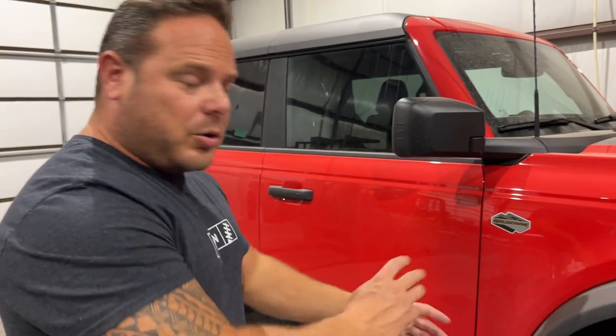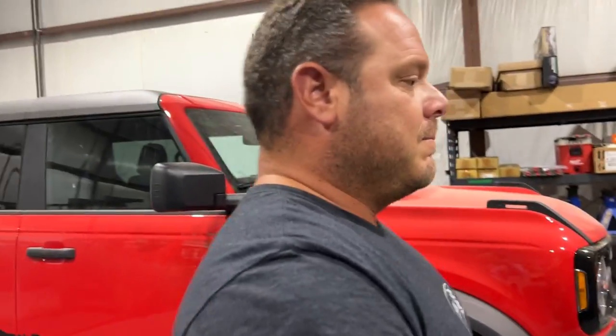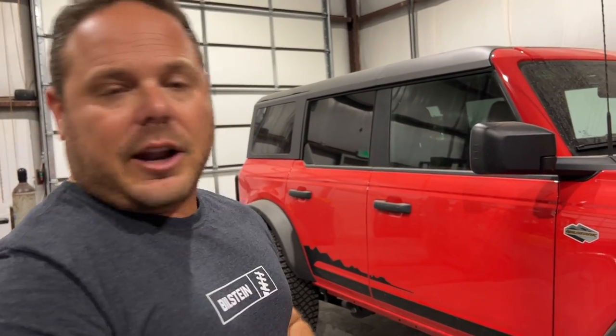Which is beneficial for off-roading for obvious reasons — we use ours basically all the time. Also something to note: if you went ahead and got a regular Bronco and bought some cool wheels and bigger tires, then decided you want a Raptor — sorry to tell you, the wheel bolt pattern is not the same. The Wildtrak is 6x139.7 and the Raptor is 6x135, so you cannot swap wheels. If you like the factory Raptor wheels from someone selling them, they won't fit the regular Bronco either.